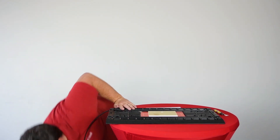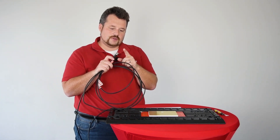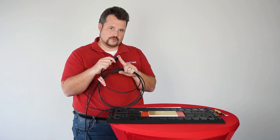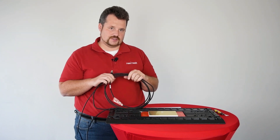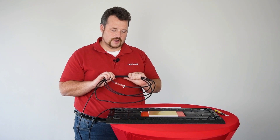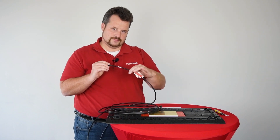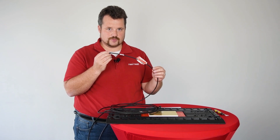The main issue is the connector on the cable. This connector sees a lot of wear and tear and can go bad quite quickly. The second effect is moisture in the cable — as you use it, sometimes in rainy conditions, moisture creeps into the coax and this actually deteriorates the antenna cable performance.